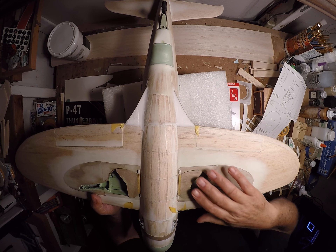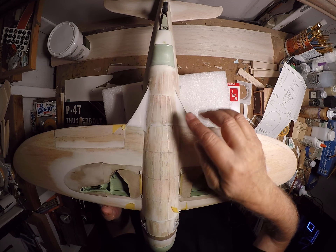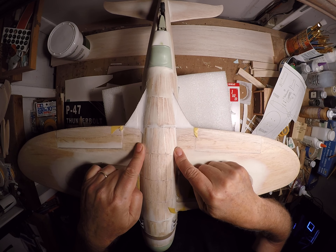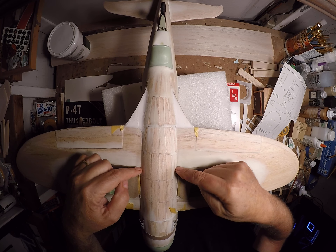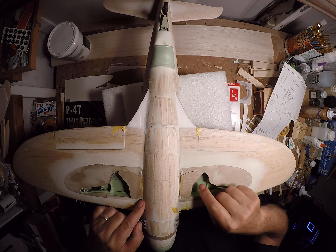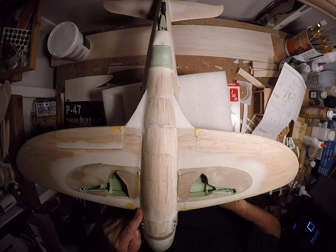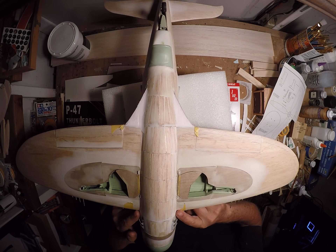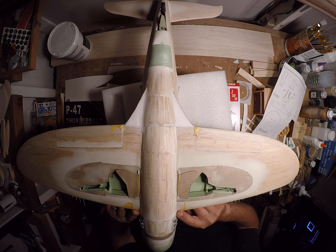Here's the underside. You can see I've got this filled already but it hasn't been sanded really. These fairings also I'll need to be adding a liberal amount of spackle coming up along the belly pan to about this point. I'll do a full stop here and then just up around the gear door hinges and then back to the front, where we'll then be rejoining with the upper wing surface fairings right here at this juncture.